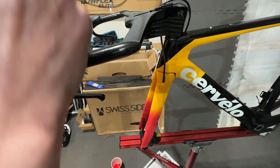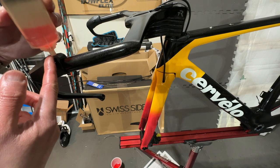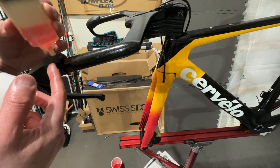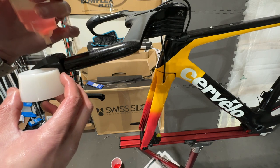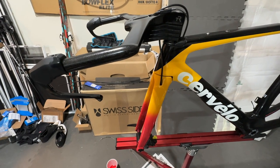So I put in the stopper and slowly undo it, and this part you just have to be super careful, because you want to make sure there's enough brake fluid at the top so that when you're putting the nuts and the washer back on, you're not introducing air back into the system. Okay, so I'm just going to put it like this. Here I'm putting the nuts back in. Let me get a slightly better angle here.